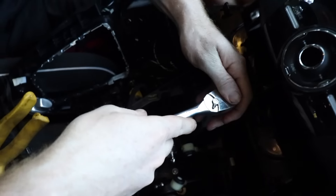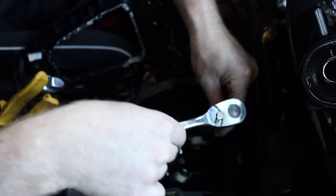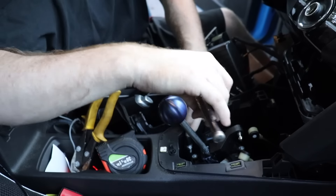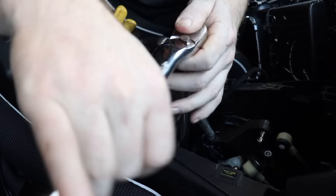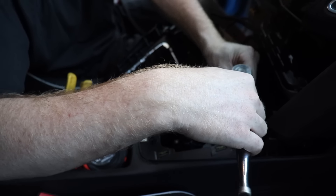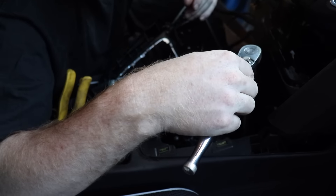If you ever wonder what the inside of your center console looks like, this is it. And there's your RCM — your restraint control module — down there if you ever need to replace that. Right now what we're doing is loosening the bolts. I'm using a 5/16 — don't know if that's correct but it's working. There's going to be four of these bolts. Probably what you guys want to do is have a 10-inch extension on hand because these bolts are pretty far down there. You don't want to get everything ripped apart then have to drive to the hardware store.